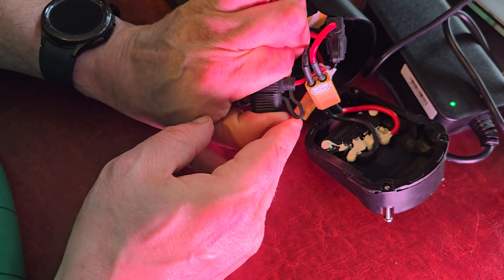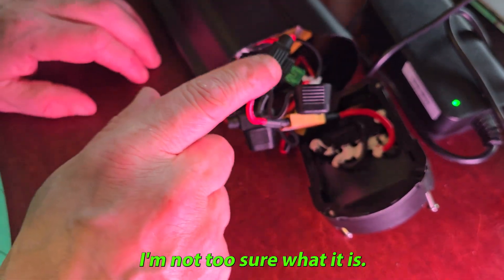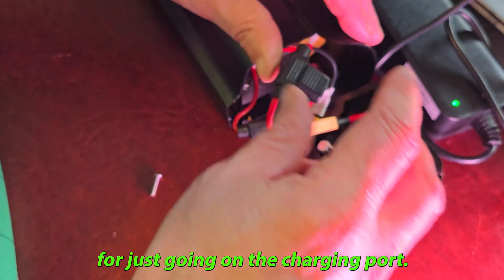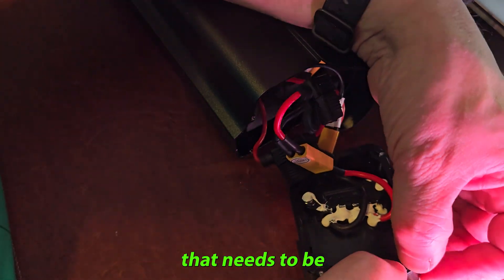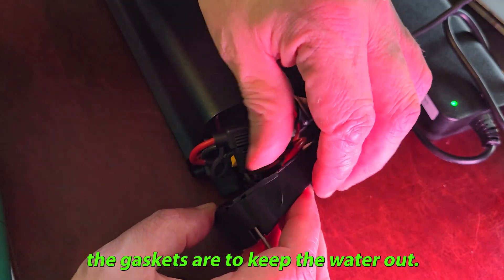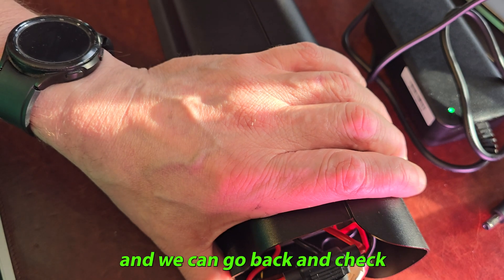That's covered. Just in case you're wondering, on the other side there's a green 15 amp fuse — I'm not too sure of the exact rating. That fuse runs from the battery into the bike, but in our case we're just dealing with the charging port. When you're reassembling this, remember there's a gasket here that keeps the water out. This is going to sit on the bottom of the bike, so make sure you assemble it properly.